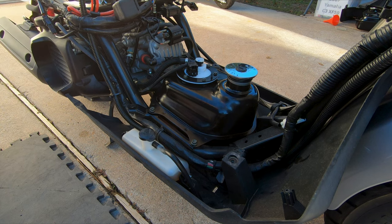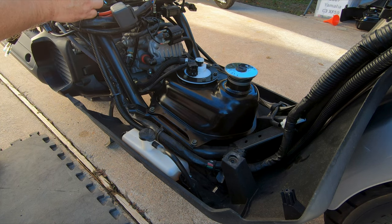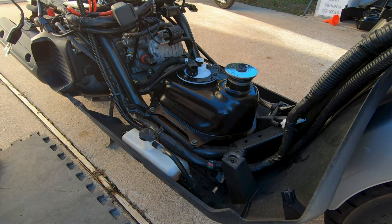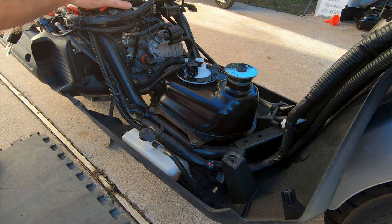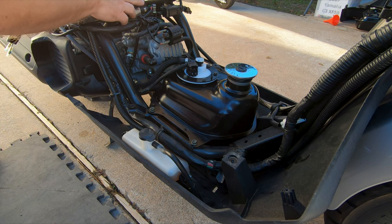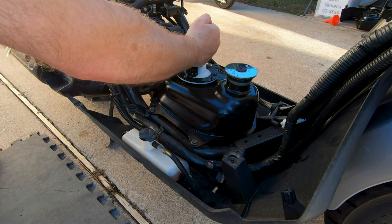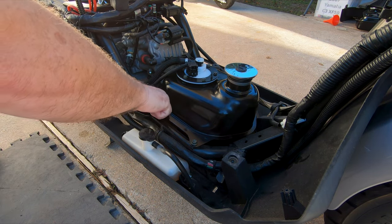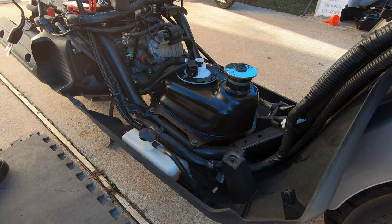All of my tail light and turn signal assembly is disconnected — that's okay. Fuel injector is connected. I've got hot-to-hot and ground-to-ground. The ECU is still plugged in, I didn't mess with that, I left it on the harness. The fuel injector has been screwed in properly. All the intake manifold stuff is screwed back in. This is still loose but that's okay, I can finger-tight it. And it's got a half a gallon of fuel in there. Let's see what we get.